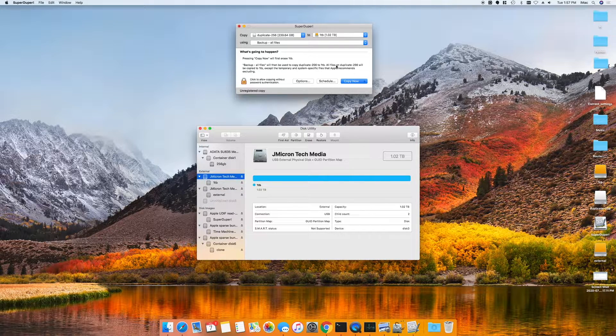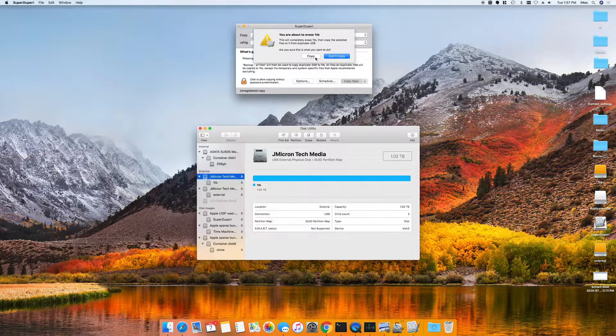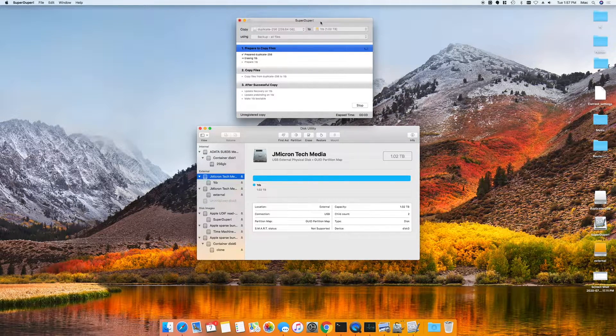In the future, I can just open up my computer, tear out the old disk, and put the new one in. Straightforward process — back up an image, save that, and restore that image onto your new drive. Just note: if you're not seeing the drive, you could format it before going through this process. SuperDuper will set everything up, but sometimes drives won't show up if they're not formatted correctly. So just use Disk Utility hand in hand with SuperDuper to get it going.